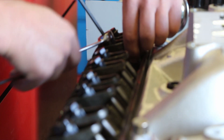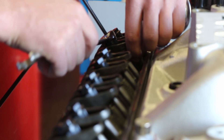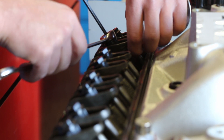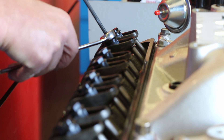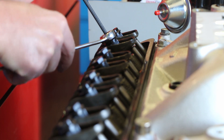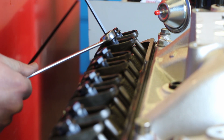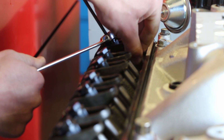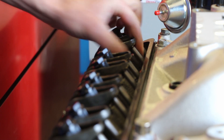Now we're on to eight intake — loosen that center nut, keep backing it off until the tension comes out of the push rod and it spins. Find where it just starts to touch. Set our center lock and then pull them in together so they bind and tighten at the same time. That'll keep them from backing off and that one's good and tight.